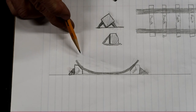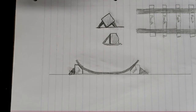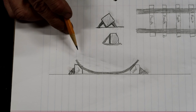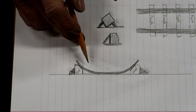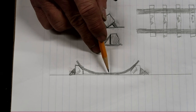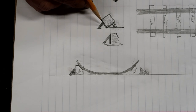Use as many rubber pads as you have racks. For a single coil I'd use a minimum of four, and for a really big heavy one probably five or six. As long as the coil is not touching the deck — that little quarter-inch or eighth-inch gap guarantees the coil is not sitting on the deck.